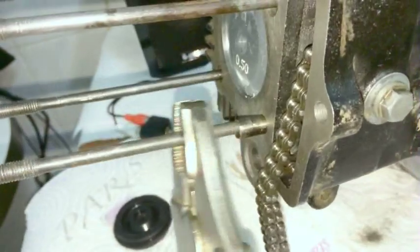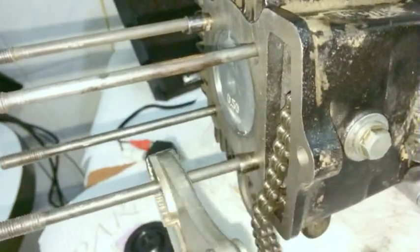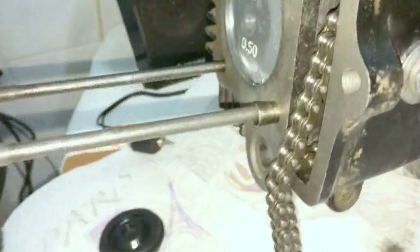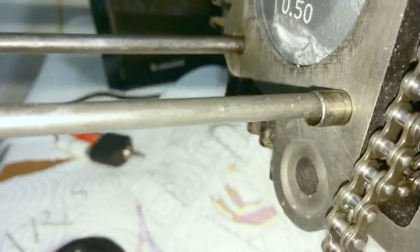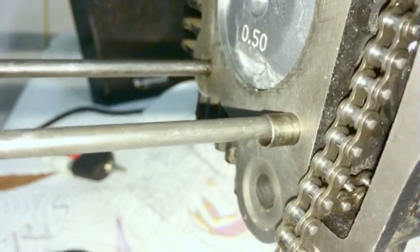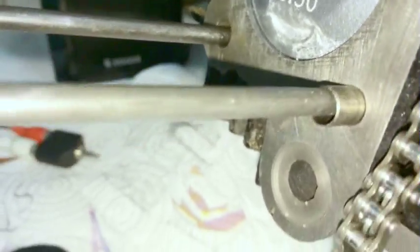I'm stuck on the camera cable. You don't clamp it down, you just use this as slight encouragement. Don't bang it hard. See, there it went in? That's all the force you need to use. If you go any harder than that, it's actually going to dent it and it won't work very well. So heads up on that.